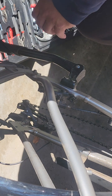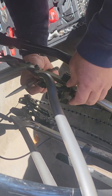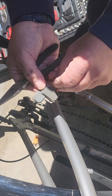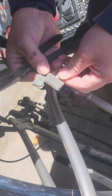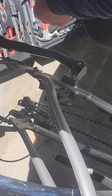You can reuse this but I wouldn't if your brakes come with a new one. All you have to do is push them out — there's a spring and then the two pads. You can see the pads are just starting to disintegrate a little bit; they're glazed over. Even though there's quite a bit of life left, I could sand those off and maybe get them to work a bit longer.